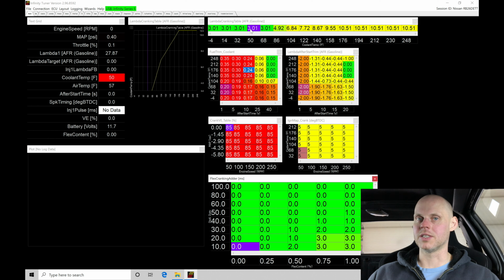One thing I do want to mention is that this vehicle does not have an idle control motor. So we have purely mechanical idle. The throttle plate is open more than we need when the engine is warm. So when the engine is cold like this, we should see that the idle is probably going to drop down a little bit because we are going to lose some of the torque from the wall wetting effect that we have going on.